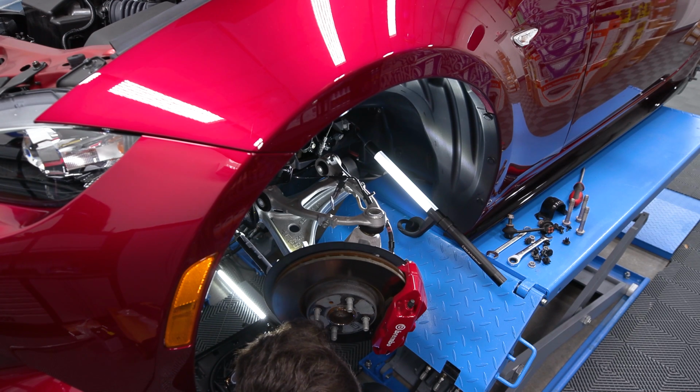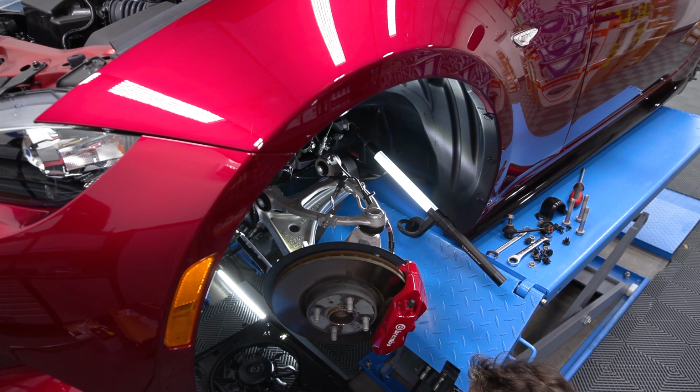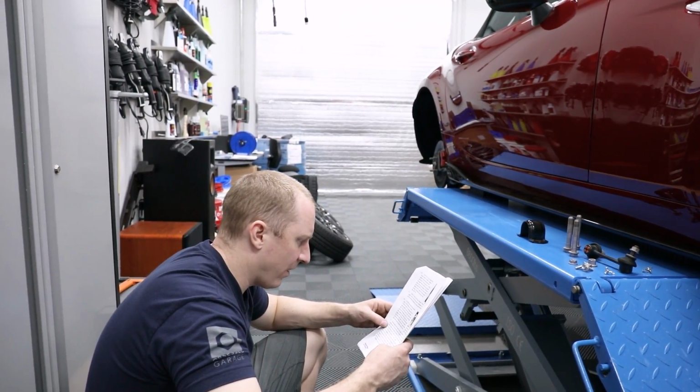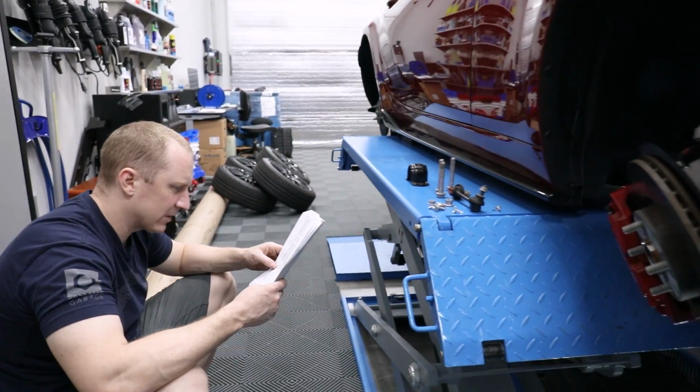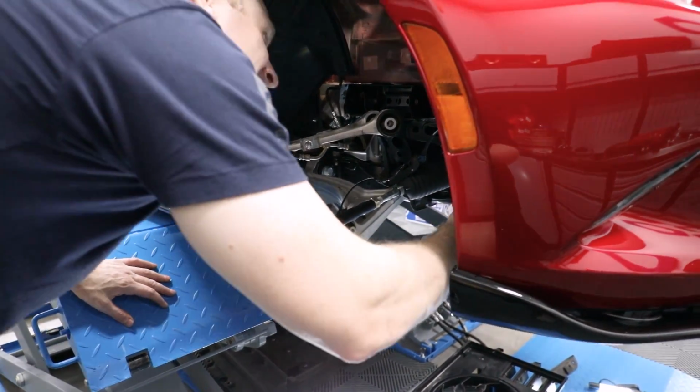Leave the bar with its ends pointed straight down. Pull the entire bar forward and begin to take it out the driver's side. The passenger side of the bar will need to move up to clear the portion of the subframe, black metal. Okay, so that's the subframe. All right, that tells us nothing. Let's just start wiggling crap.